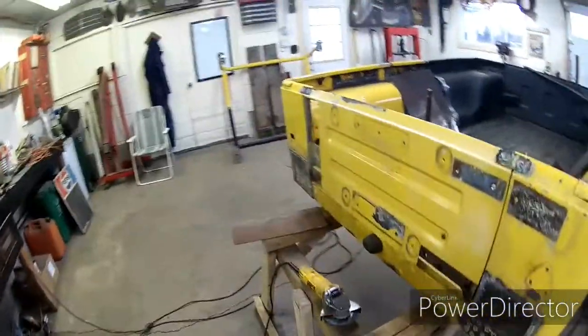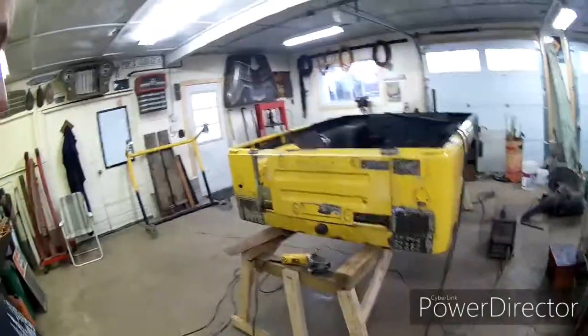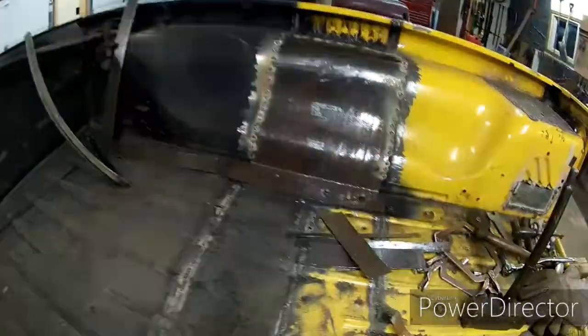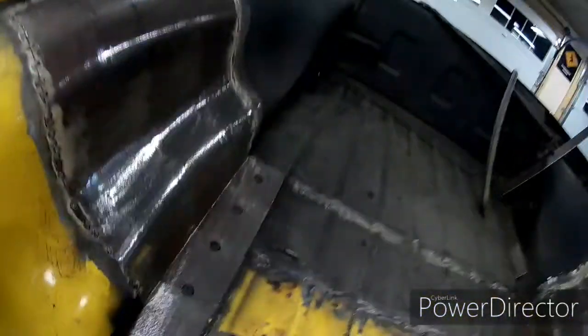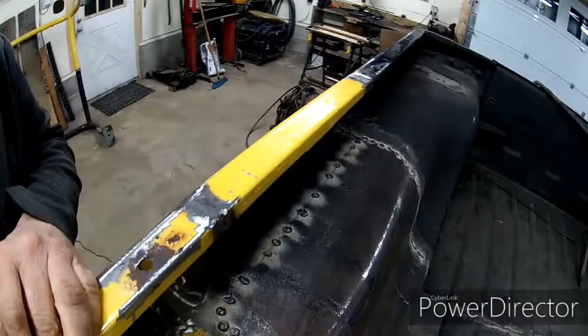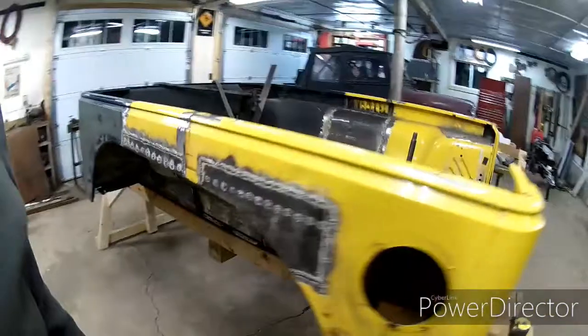So stay tuned - it's a slow process. We're just trying to make something out of scrap. That's the goal here - not spending anything but zip wheels and welding wire. So we talked about the patches we wanted to put in. We structured these patches, broke them at the bottom. Those four holes you see are the original front seat hinge holes - just eight millimeter thread. We used some of the hardware we had left over, then curved the panel in place and attached it with a bunch of spot welds. We'll continue some of the welds for strength and we're going to seam seal along the bottom. Now that we've pulled it all up in place, you can see the original floor being pulled nice and straight - it's pretty solid, doesn't move at all.